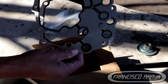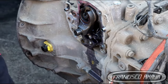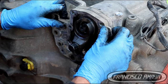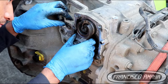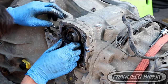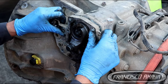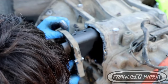To get access, we're going to remove the shifter — the shift lever and all these components right here. Removing all that requires just an E7 bolt that holds the plug with the shifter, and a T45 bolt that holds the bottom part of the shifter. Once you get those out of the way, it's pretty simple. You get it off and you can remove the whole shifter — just move it up and down until you get it out.